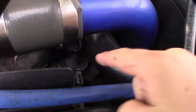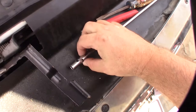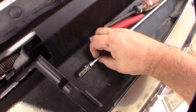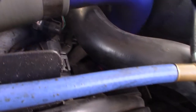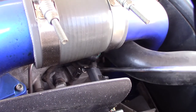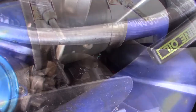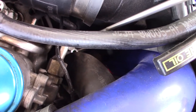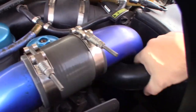I'm going to take off the coolant filter hose and the top radiator hose. Down there there are a couple of 10-millimeter bolts — that's the thermostat housing right there. I'm going to use a 10-millimeter flex bit. Nothing makes it easier than a magnet tip to pick up the bolts. It's easier to just take this off in one piece, keeping it on the hose.